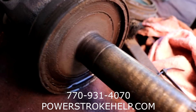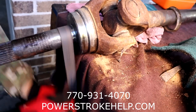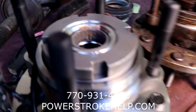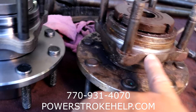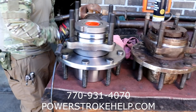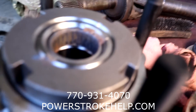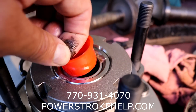See, this axle's ruined - I wouldn't run it. Luckily we were able to make a phone call and get another bearing, and we had another axle sitting out there that was good. Dennis is over here emery-clothing it to make sure it's right. But put some grease on this inner bearing when you guys put these hub bearings on. I've probably seen a hundred of these things come in and the actual bearing itself inside here is fine - there's nothing wrong with it - but it'll tear up these axles. Do the hub bearing right, put a lot of grease on it.